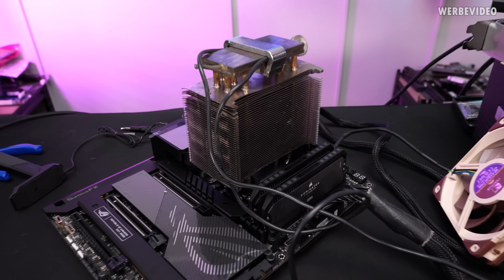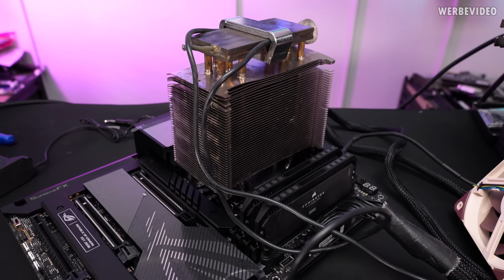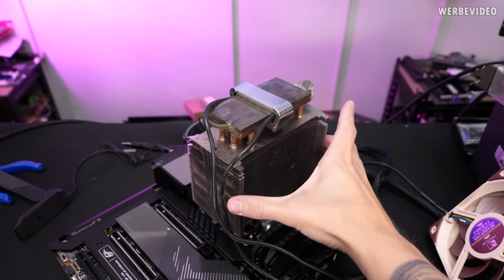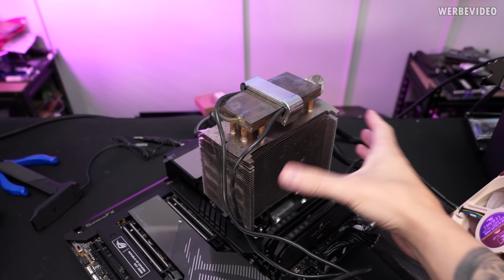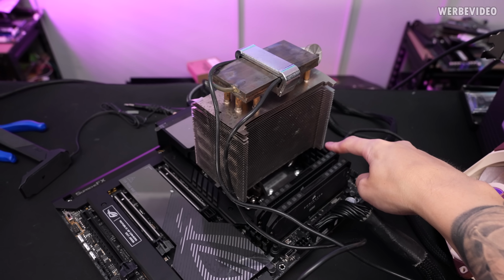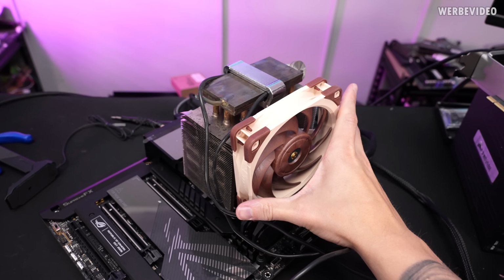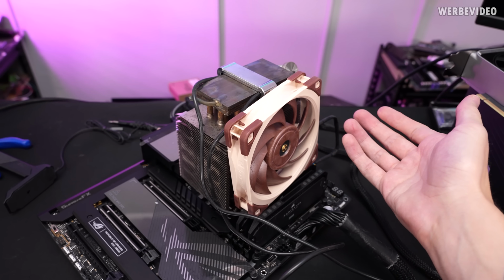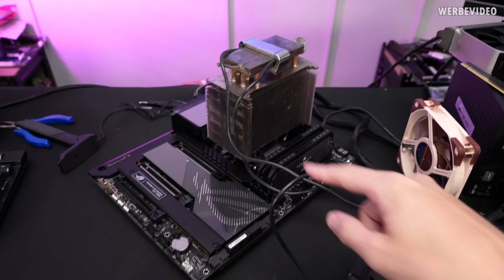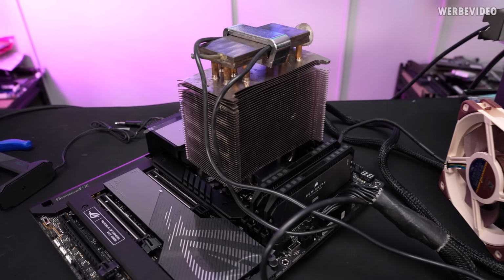Finally, managed to attach the cooler. And if you think this looks crappy, then I totally agree with you. The thing is, with this LMX by Danamics, I had to remove the plastic shroud on the side because I just reassembled it, but then figured out that the plastic shroud just collides with the VRM cooler, so I had to remove it. Now I have to figure out a way how to put the fan on top, but I think I will just use some probably zip tie, something similar, to just hold it in place. Then wiring goes to the controller board, and that's pretty much it.